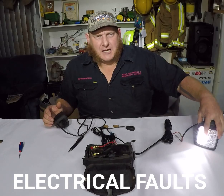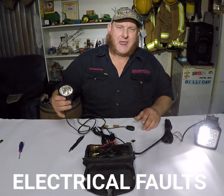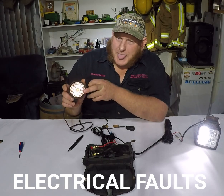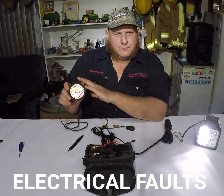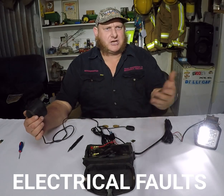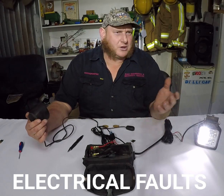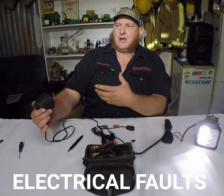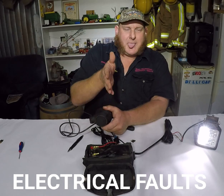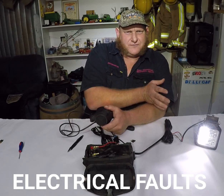The light glows — not very well because it's an LED, but it glows. So what you do: take the fuse out and put this in. Point it towards you so that you can see it — you've got 20 meters of truck, could be a road train, whatever. You can isolate it between the truck and the trailer, but you've still got to find exactly where it is.